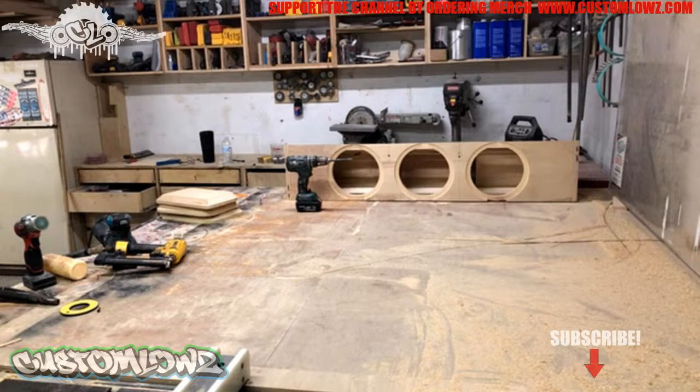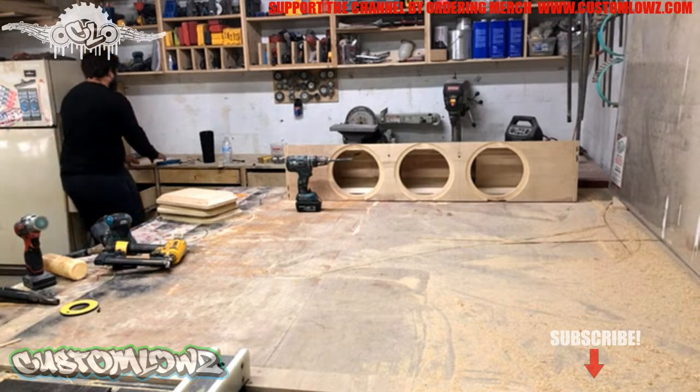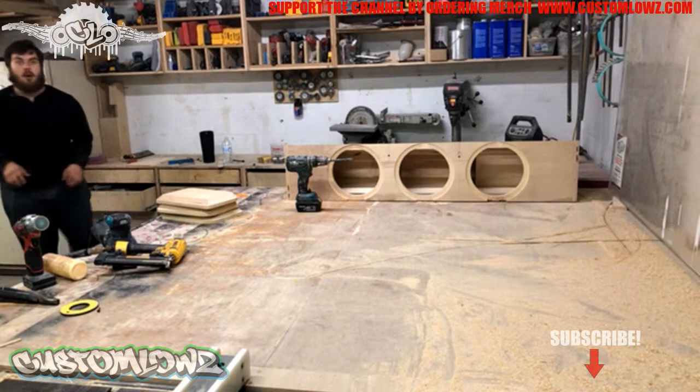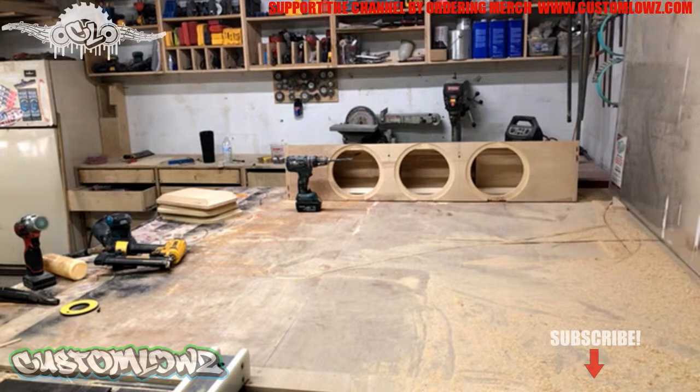35 square inches of port for 4/8. I mean, in an underseat situation, yes. It's only 800 watts and small motors, but I'm trying to learn. You could probably do more, but it depends what situation you're in. I believe this enclosure, for example, it's 3/10 and we only have 25 square inches of port area because really you're so restricted on fitting the subs in there with enough space and having enough port area to the box.